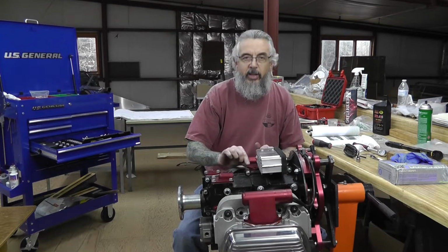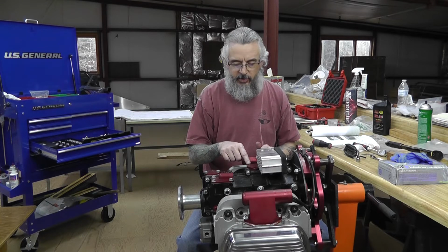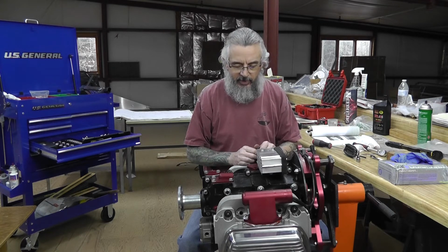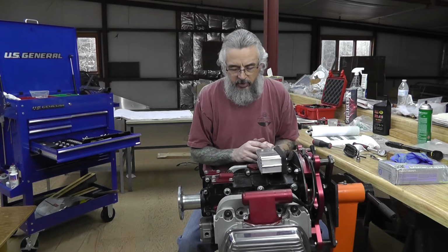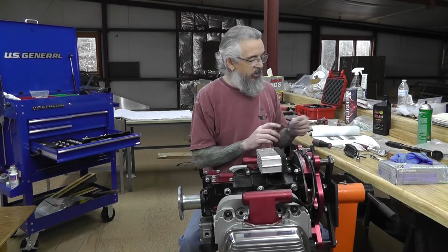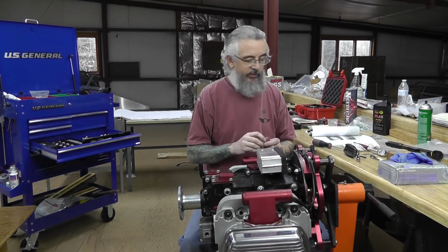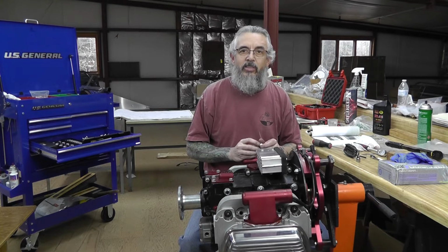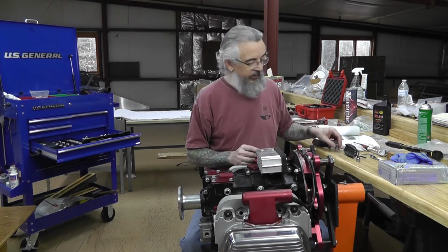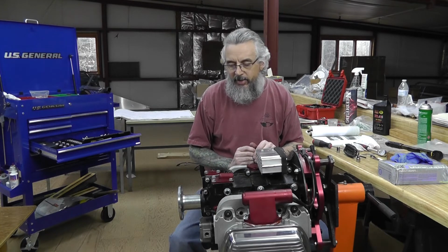But yeah, Sonex guys, if you're watching, leave a little more relief around these bolt cavities here, because a little too snug on the 7/16 sockets leaves no room. Increase that by 10 thousandths even. Make a big difference. Because I even went and found my smallest outside diameter 7/16 socket downstairs, and that didn't want to fit. So apparently the one I had up here was just a hair smaller. So allow for some variance in there, please. And yeah, one more part of the engine's done.